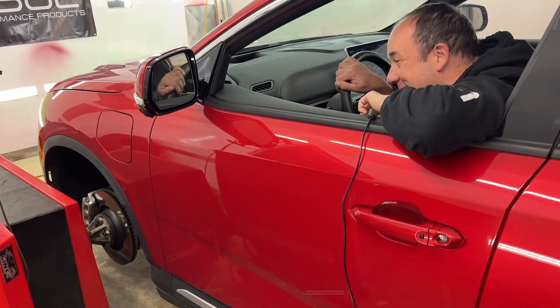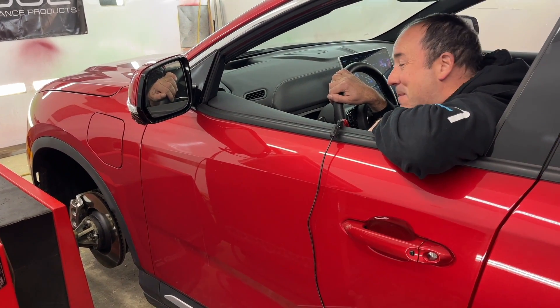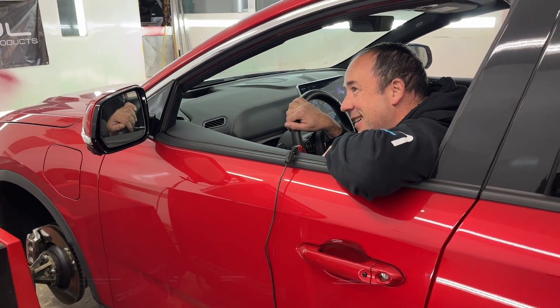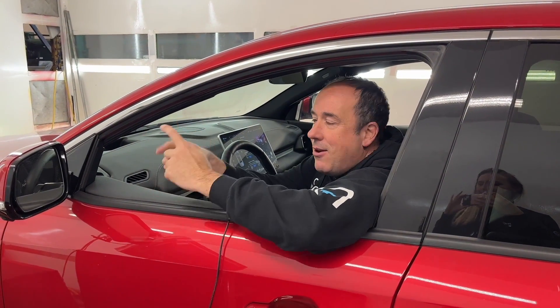The front wheels are going in opposite directions — that's amazing. Yeah, this is a VCU calibration problem. This one started to spin and that one went forward, then reversed, then went forward again. That can happen when they lose track — it still applies power.